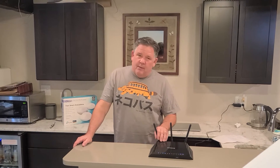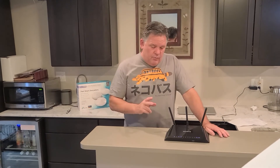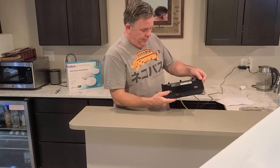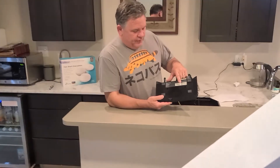What we've done so far is hook up our wireless router to the cable modem — that's all you need to do for actually hooking it up. What you need to do next is connect your various devices: your phone, tablet, television, and so forth. There are several pieces of information you'll need, but two that come up immediately: you're going to need to know the SSID, which is the name for the wireless network that you'll see when searching for wireless networks on your computer or phone. I don't know about all manufacturers, but Netgear is really good about supplying that information right on the bottom of the router.